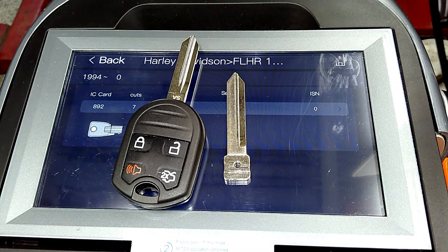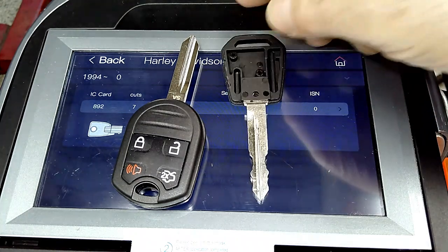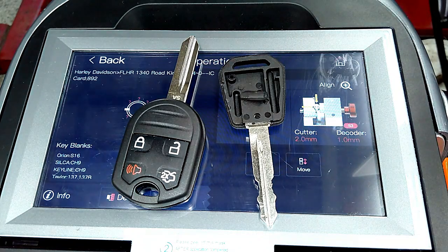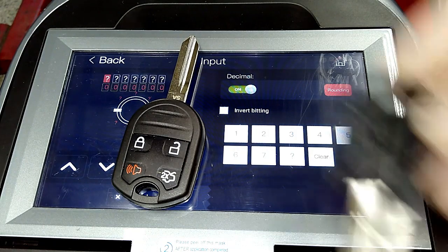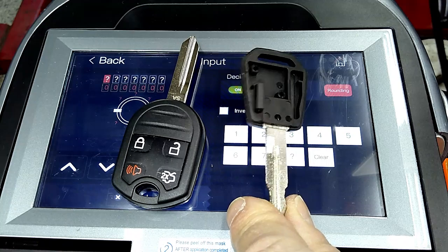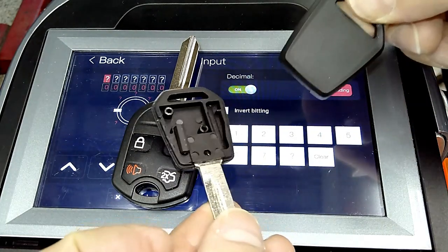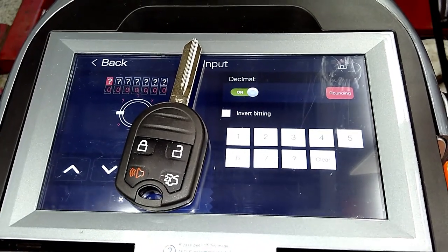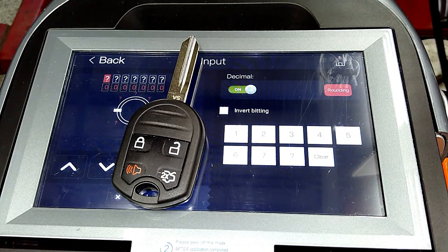What we're going to do is cut this key. I've already made a cut on this one right here. Then we're going to put in this 80 chip — we're going to talk about these different chips. This is an immobilizer chip. I'm going to take that chip and stick it in the key fob right here. See where it's in there? Then I press it down, put the head all together on it, give it a little snap. And we've got basically a key that we're going to use in the vehicle.